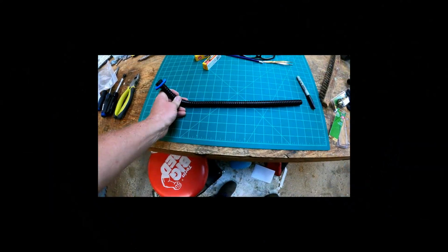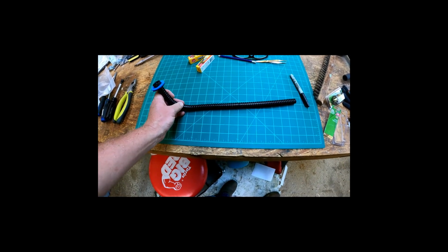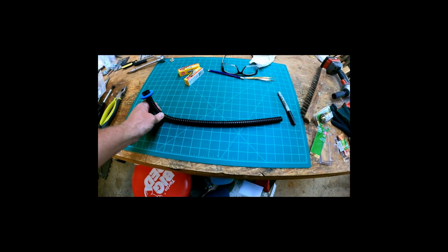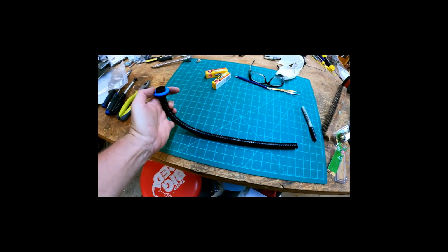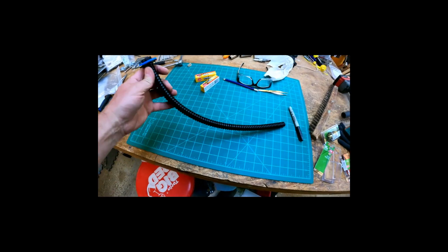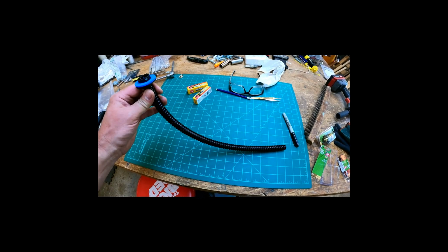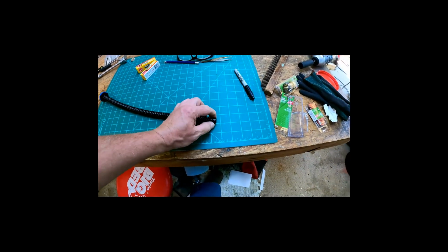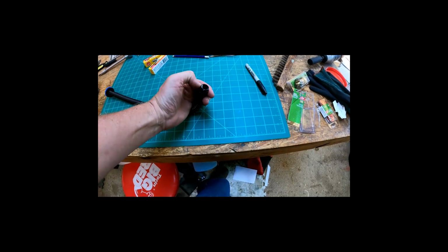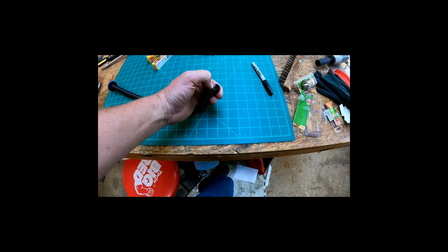Okay, so first thing that I'm going to have a little bit of a hiccup with. They're saying no drilling required, but I was actually kind of curious about how this was going to work. This is a drain tube. This portion of the drain tube has 2 little nipples that stick out. They mount in the bottom of that, what I just set in the truck, and kind of turn and lock in there. And they are hoping that you have some type of hole in your bed that came from the factory, and this needs to go down into it.